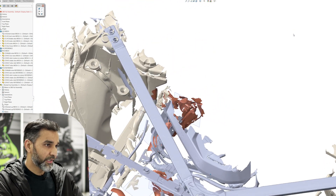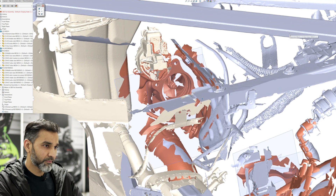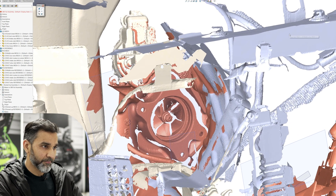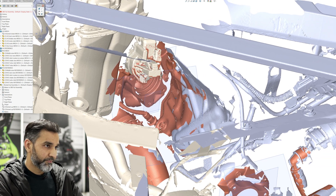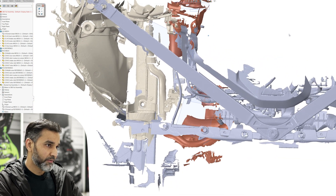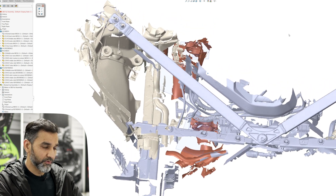The good thing about this system is that you can actually see the turbos. Zooming in to the left side, right there you can see the impeller of the turbo. It is quite close to that heat shield on the side, but there's still enough space to develop something of a larger size. You can see the wheel arch area, the duct, and the strut brace at the top — so that's the envelope in which we've got to work.